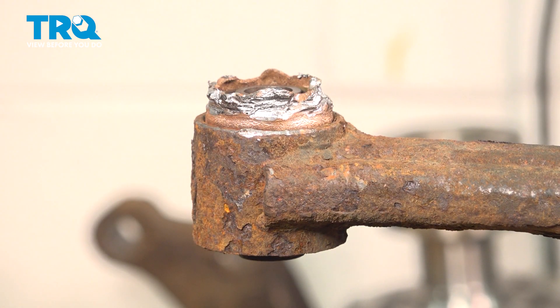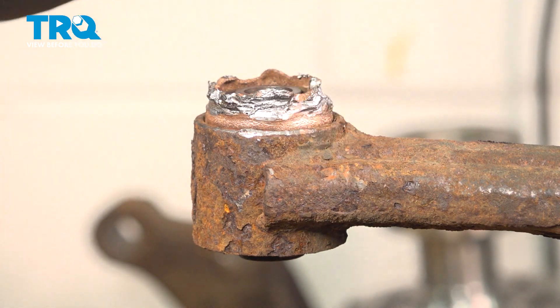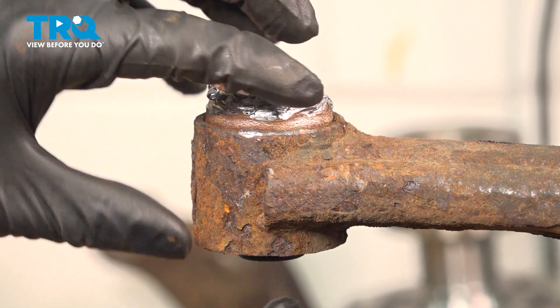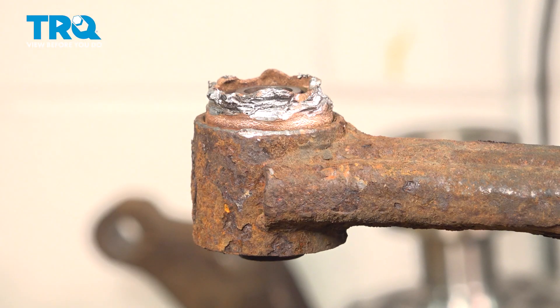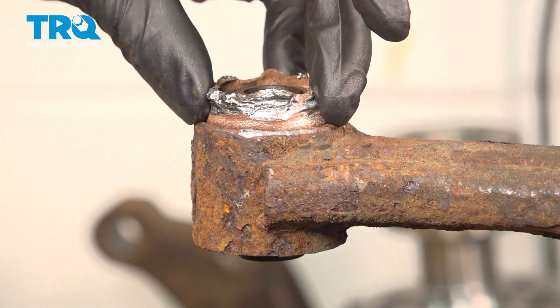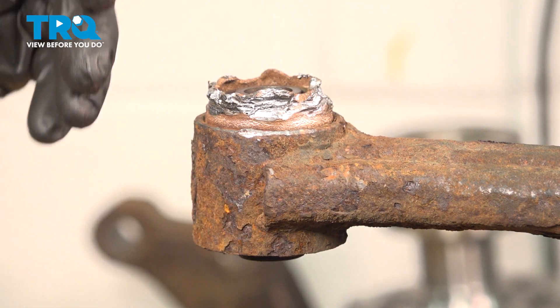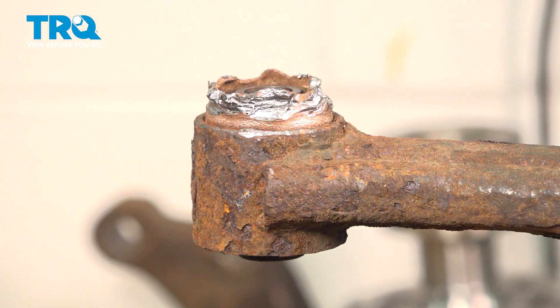At this point I'm pretty sure we've narrowed it down enough to where I can fit a cup right here and press it out. Whether it presses out just the center piece and rips it apart or presses the whole thing out, either of the two work. The outer sleeve is most likely going to be stuck on the control arm and we'll have to press the inner sleeve out, get the rubber out, and then press the outer sleeve out. Here's the setup we're going to use — a manual ball joint press, which is basically the tool made for this job.